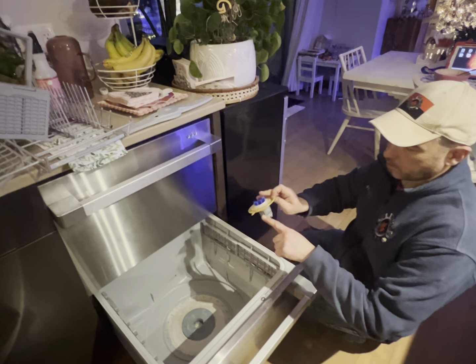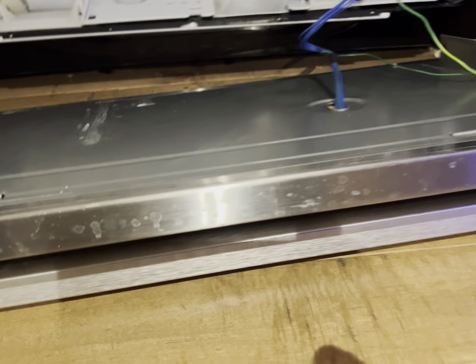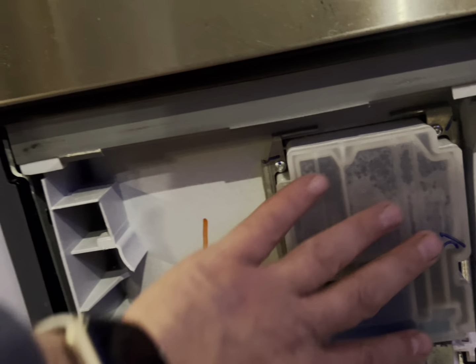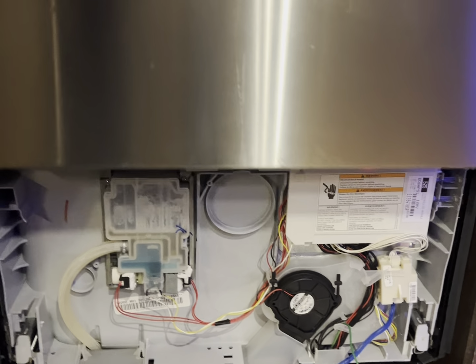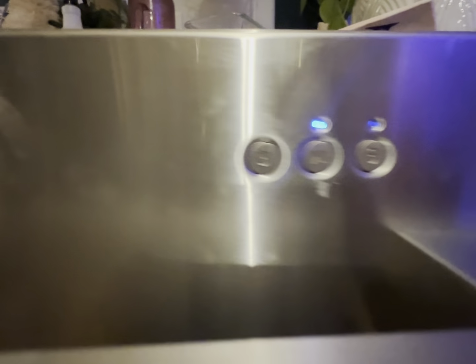Structurally, the DCS Fisher and Paykel dishwasher consists of two separate small dishwashers combined into one body. Therefore, both the upper and lower sections can be checked using a service test. In my case, I partially disassembled the lower section and launched the service mode. And on the upper half, I conduct a step-by-step demonstration of entering the service mode.